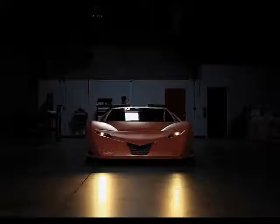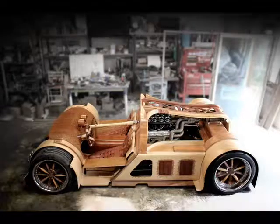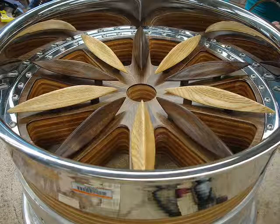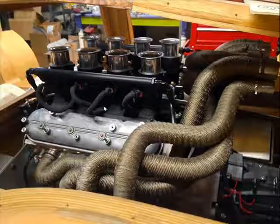The monocoque chassis is made almost entirely from a series of bent and molded laminates, with each chassis component formed, fitted and trimmed using a custom mold and bonded together to create the structure. Steering is provided by a 12:1 rack and pinion setup comprised of multi-piece tie rods. Front suspension is A-arms made of upper and lower laminated wood of unequal length with height-adjustable airbag springs and adjustable shocks.